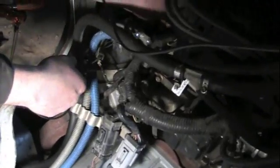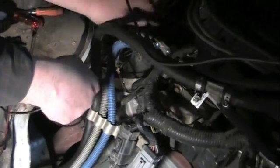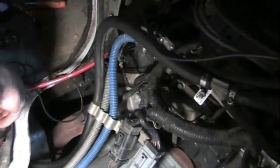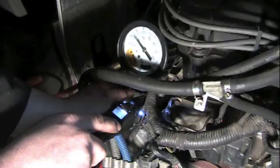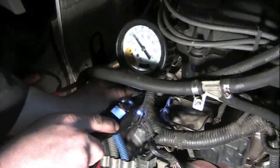Well, again, the ohm test is pretty unreliable. We're showing you this because it can be deceiving. We're not testing that injector under load. We need to check it when it is actually doing something. We know that the computer is commanding that injector on. The ohm test at this point we're going to ignore, and we're actually going to power that injector.